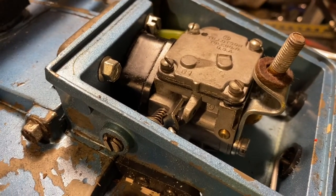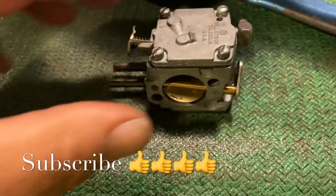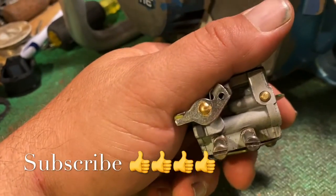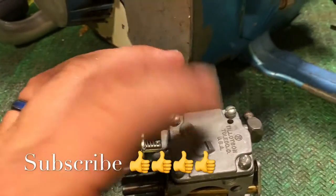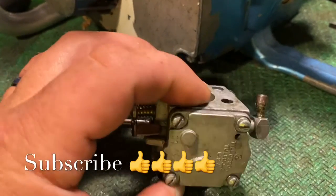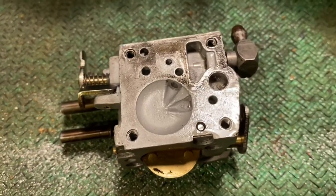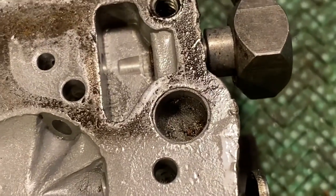Here's the carburetor. We're going to pop that sucker out and give it a good examination. It's a Tillotson HS142A and that is correct for the Super XL Auto. Let's tear into this — just to make sure. We'll pull it apart on this end just to see if there's anything restricting fuel flow. We can take a look at the screen and so forth, and see if there's anything in there restricting fuel flow. There's the carb — we do have some debris in the screen. So we've got to clean that out.